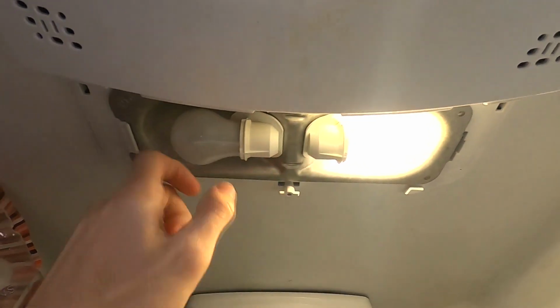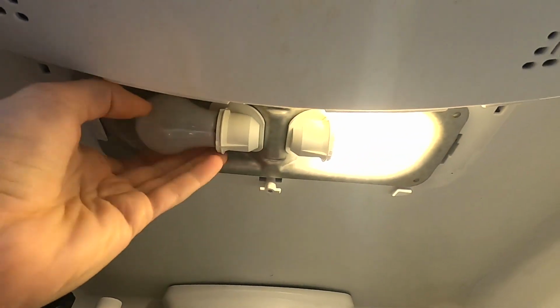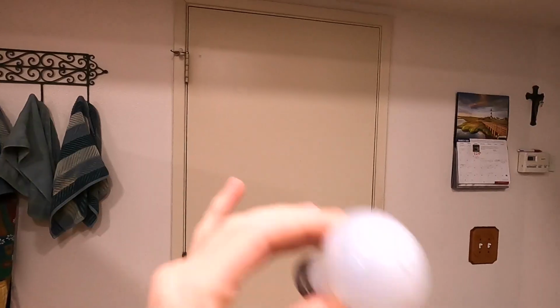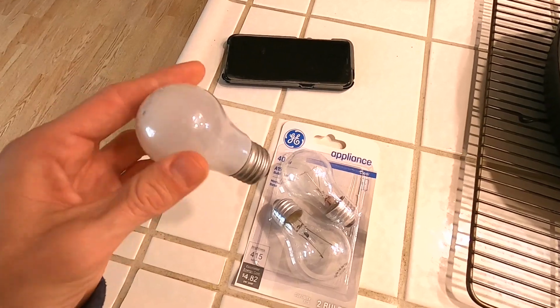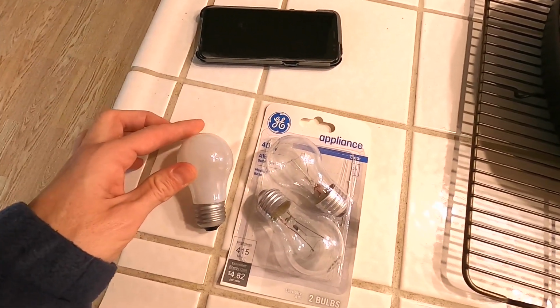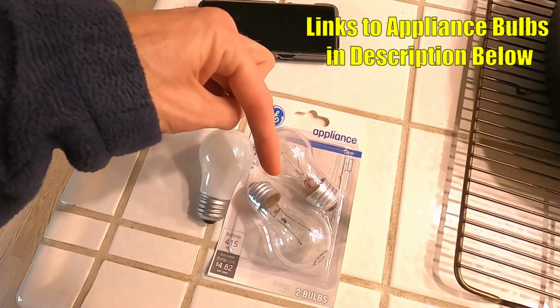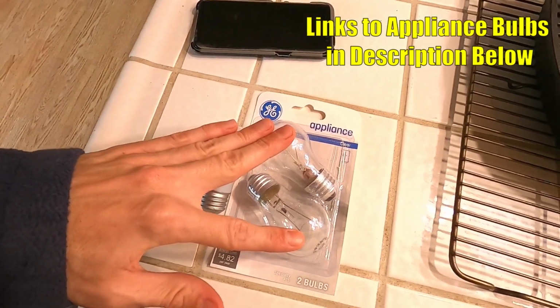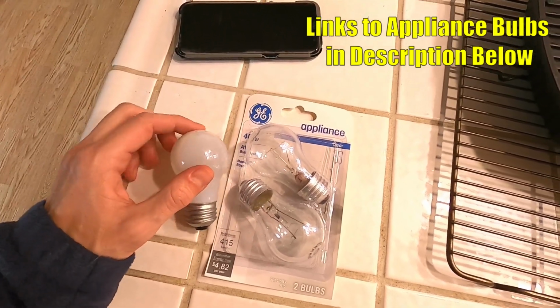And then if we look up here, there's two light bulb sockets. Looks like this one on the left is burned out, so we'll just go ahead and unscrew that one. Yep, it's burned out. So your refrigerator is going to use smaller bulbs than you normally use. These are A15 medium base bulbs. I'll make sure I go ahead and put some links down in the description to some replacement bulbs for you guys to check out. I'll go ahead and put some LED options too if you're looking for something brighter.